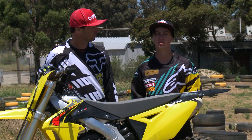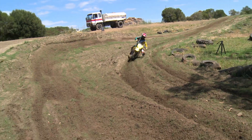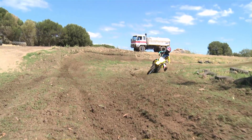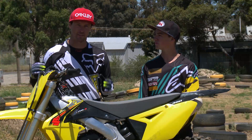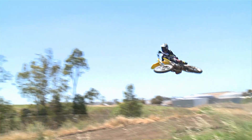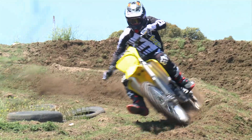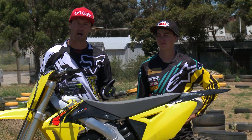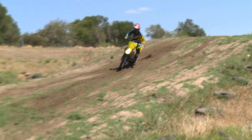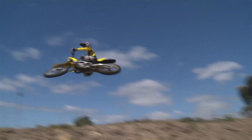When I first went out there it was a little bit spiky on the smaller bumps, but we added some air to the balance chamber and it actually made a lot of difference to the whole ergonomics of the bike — it handled a lot better and made the frame feel a lot plusher. The engine is super smooth with a lot of power, and the rear shock balanced up nicely with the forks. Even between a lightweight and a heavier rider, we could get these forks working sensational for either one of us.